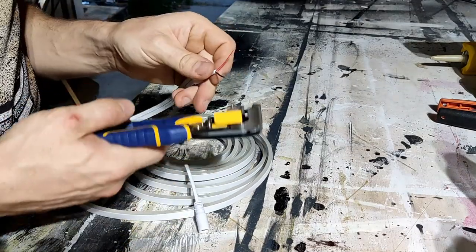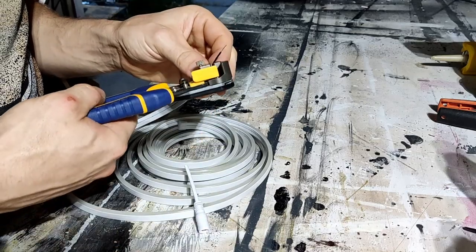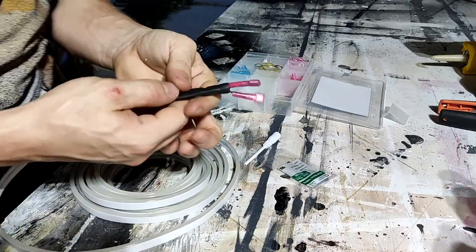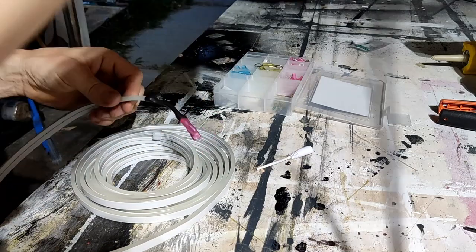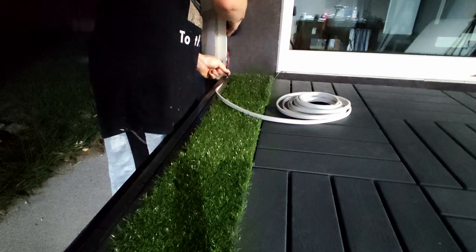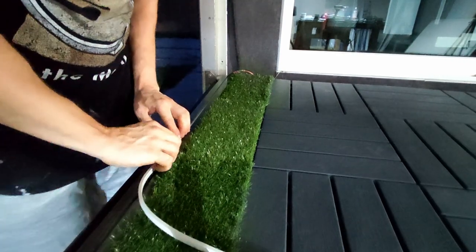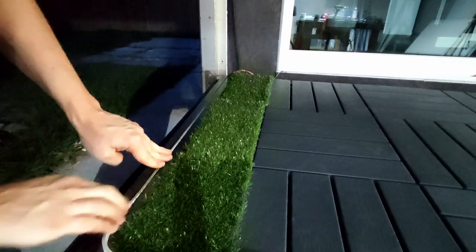The LED rope I'm using is a flexible 12-volt LED strip with a built-in diffuser. So it's going to look like one solid light wire as opposed to that cheap-looking LED rope where you can see where each individual light is — that just looks cheap, and that's one thing I really wanted to avoid. All I have to do is strip the ends — it's already set for 12-volt and I've already got the truck wired — so all I have to do is add some connectors and then start stuffing this into my channel.